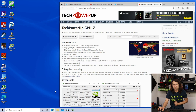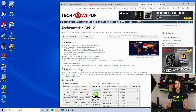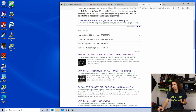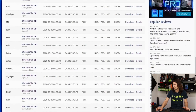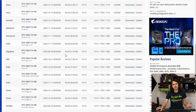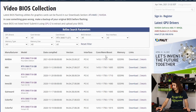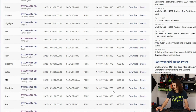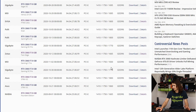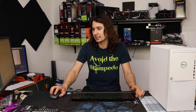Then we find a different BIOS to flash to it. I just Google '3060 Ti BIOS' — I'll have links in the description. Here's a full list of all the open downloadable vBIOS files for 3060 Ti's. The best one is going to have the highest boost clock — all the base clocks are the same, all the memory clocks are the same, but the highest boost clocks seem to come from the Asus cards. So why not flash one to your 3060 Ti and see what happens? I'm going to download the Asus one.